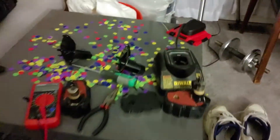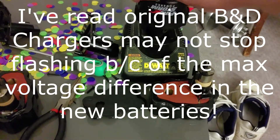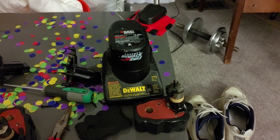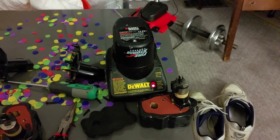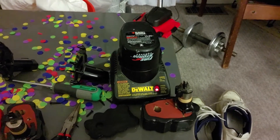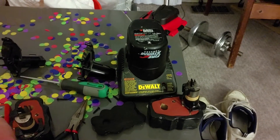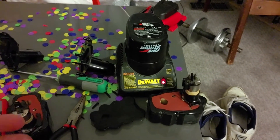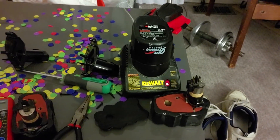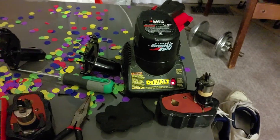Just to prove it — this DeWalt charger, and I think your Black & Decker will do the same thing, charges up to 14.4 volts. I tested the battery and it actually goes up to over 16 volts, so it's a very powerful battery from the aftermarket — all the more reason to be careful with your gearbox. The motor between the FS1320 Firestorm and the PS1420 appears to be the same; the difference might be in the gearbox.